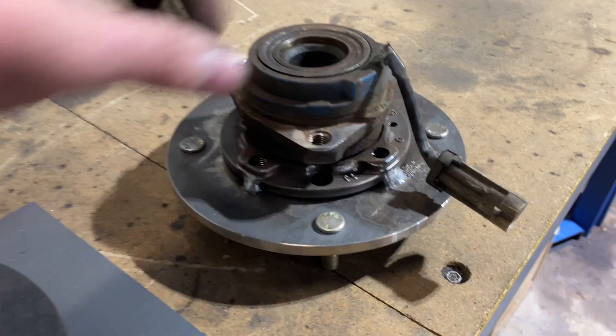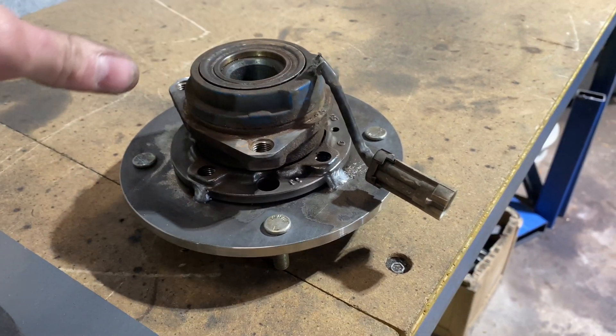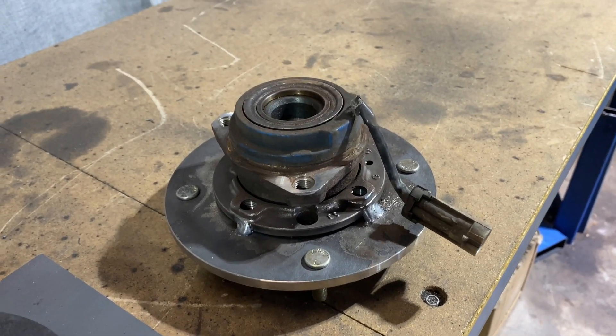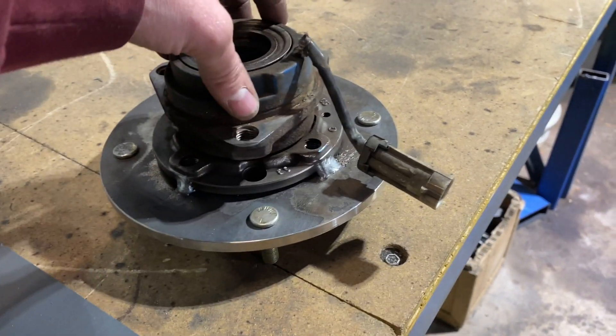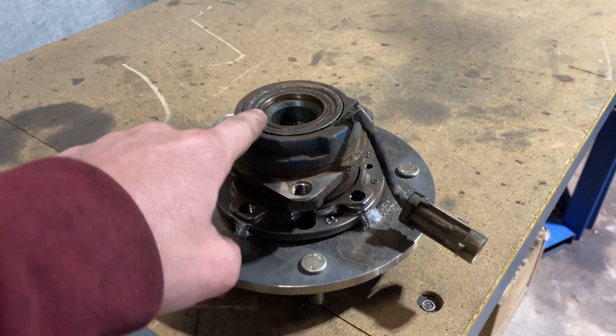I just noticed there's a little bit of movement in this bearing. I want to mention that I haven't altered these hubs, so we can still take them apart and service the bearing inside — you can still buy them online. This is just changing the PCD pattern, so we can still press that off and put a new bearing in if we have to, which we most likely will on this one in the future.